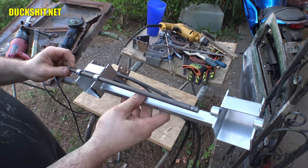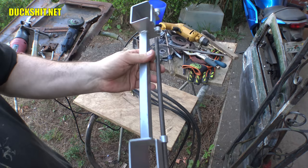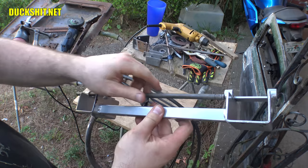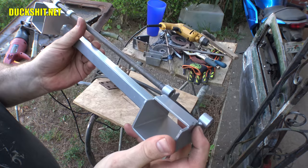Otherwise, what's going to happen is, as you open and close the door, the hinges are gonna bind, or they're gonna start squealing. They're gonna act choppy. You open it and it's gonna chatter. That's wrong. So anyway, both sides are off for exactly the same reason. If I pull this rod out and I feed it through the other direction, it aligns with three of the pivot points, no problem. The fourth one is the one that's off.